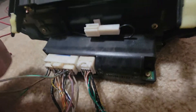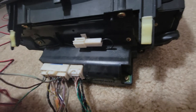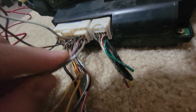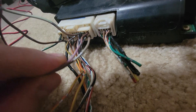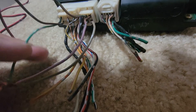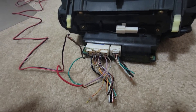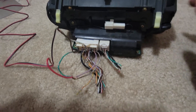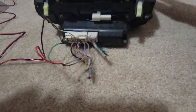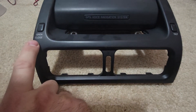Those two are connected to ground. Then power is connected to those two far-right pins on the left connector and then the upper-left pin — you can see I'm wiggling it here. All you need to do is connect that to switched 12 volts and the button on the front of the unit will open and close. This will work just like OEM.